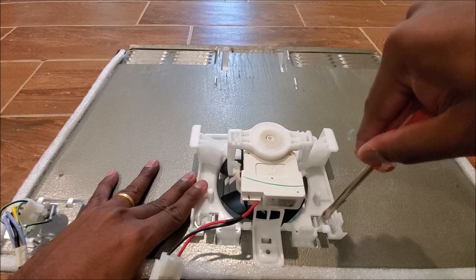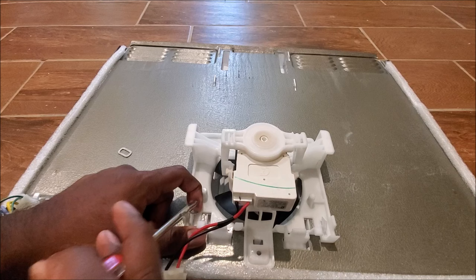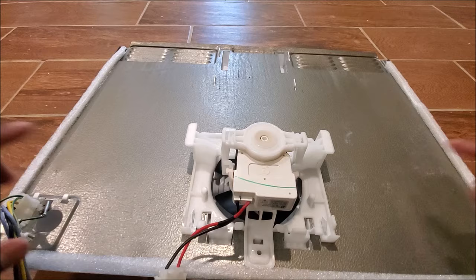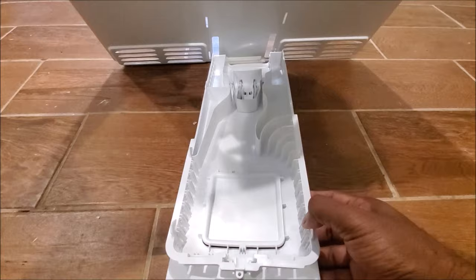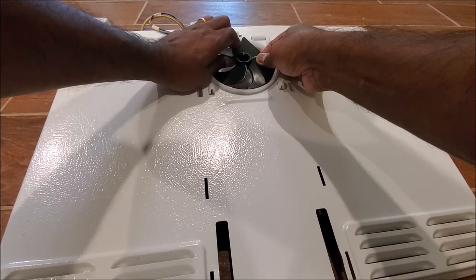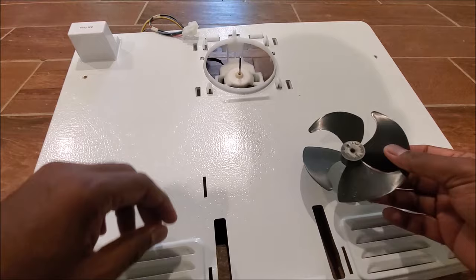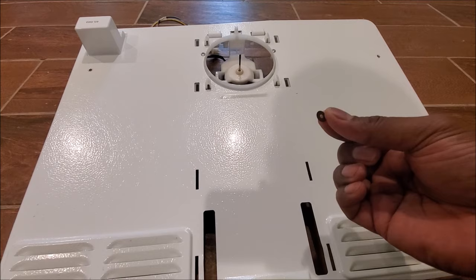First, let's take these safety clips out — basically turn them straight and they come right off. Do the same on the other side. The safety clips are now released. The whole channel falls down, as those clips were holding it mounted. Now we have pretty good access to the fan blade right here — I believe I can just pull it right off. There we go, comes right off. I also see a little washer which I'm going to reuse on the new equipment.